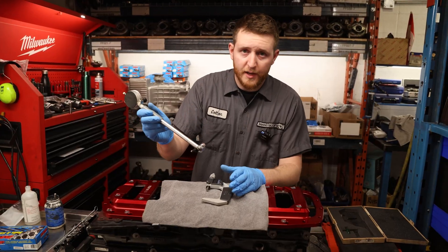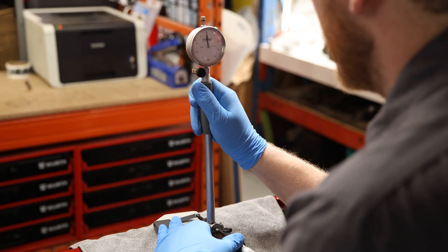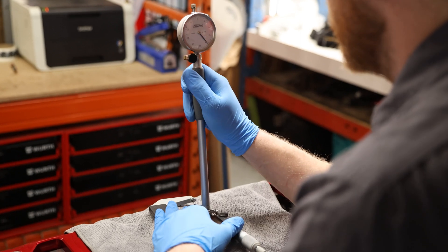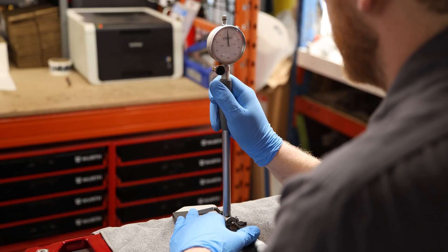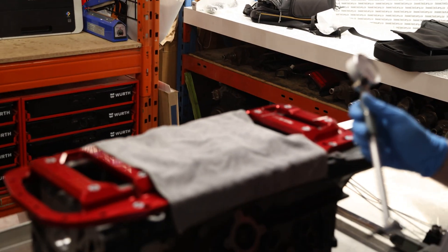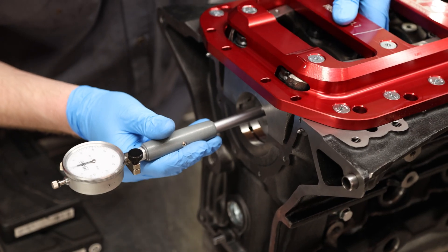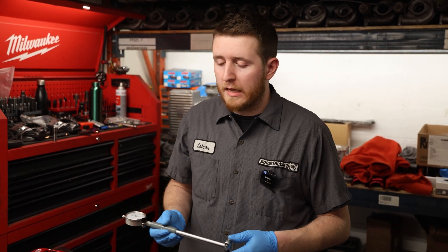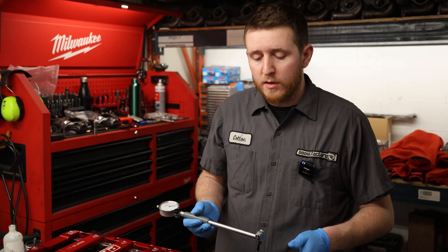When setting a bore gauge, you're going to do a left-to-right sweep and a forward-and-backward sweep to ensure you're totally zeroed. If you can't hold it in the micrometer, just take it out and set it to the area you think it will land — left and right, then forward and back — and it should always land back at zero. Once you have that done and you've set your mic, we can start measuring the main line. Now that our bore gauge is zeroed, we measure each line bore hole. This one is on the tighter side of the Nissan specification — the smallest size Nissan would recommend — which is very close to what ACL recommends anyway, so we're in the ballpark.